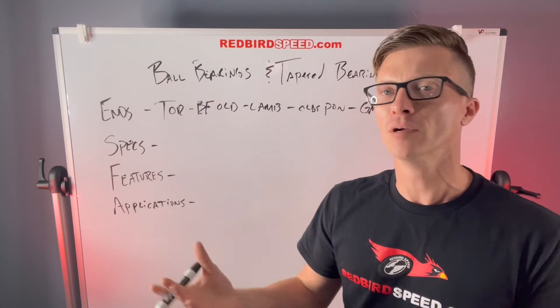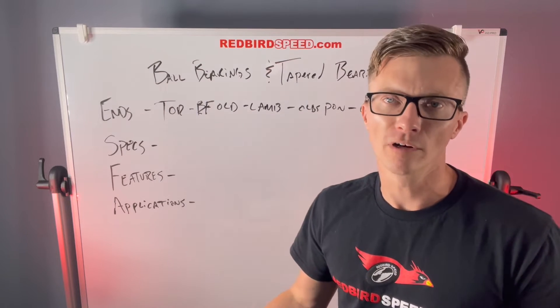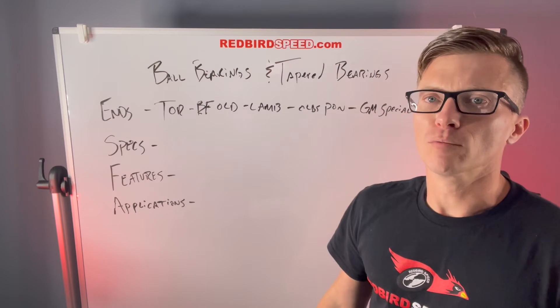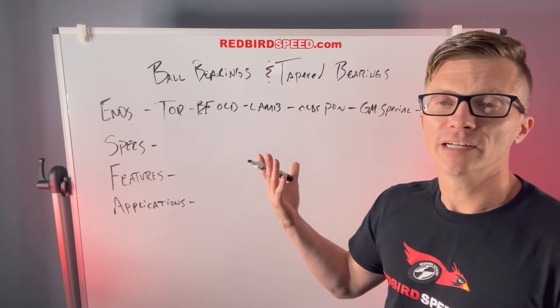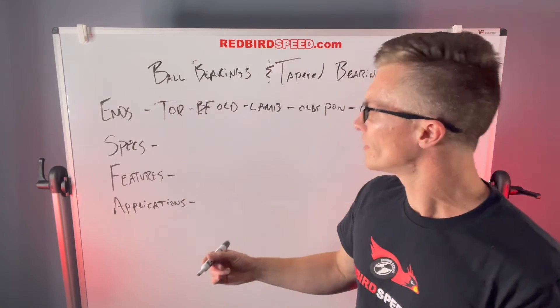You run a 3-150 bearing, open up the backing plate, so it gives you that stronger bearing but you can use your Fox Body drum brakes if you wanted to. There are options for the newer SN95 and 05-14 as well. Also a GM truck — pre-1987 — so you can use your stock drum brakes in the truck also. A lot of options there.